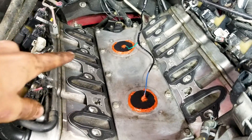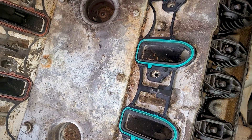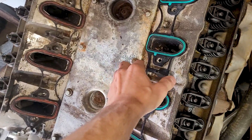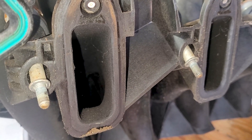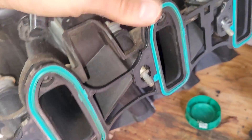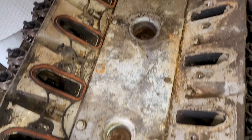The metal ones are the best — a little harder to work with. Once you clean up all those sealing surfaces and get the metal nice and clean, get the intake perfectly clean, you put those metal intake gaskets right on top of the motor, drop that intake on there and tighten it down, and it won't leak for sure. If you're doing the metal ones, they sit on the block. If you're doing the plastic ones, they clip onto the underside of the intake. The sealing surfaces are always carboned up — I deep clean them before putting them back together. The plastic gaskets clip right on there and make it easy to install, but they don't seal the best. The metal ones are definitely the best.